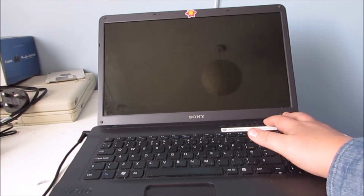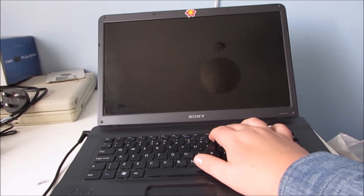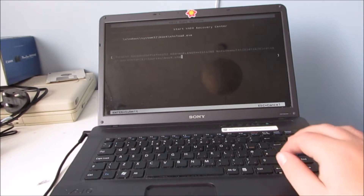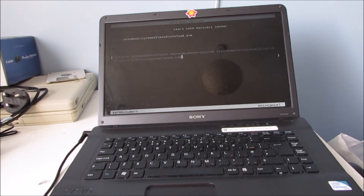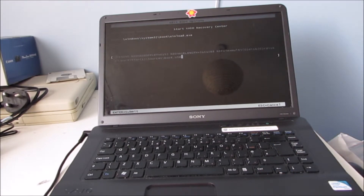It's quite simple — we've just got to press power on and then F10. Then you need to press Enter where it says Edit Boot Options, and maybe Enter again. This might happen where it freezes, but it's just a simple case of rebooting it, which is rather annoying but can't really be helped.